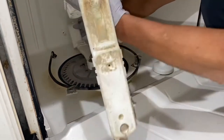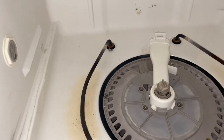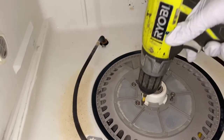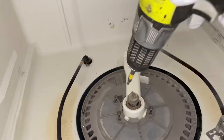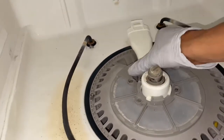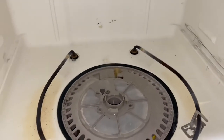Be careful when you're doing this because you don't want to break them. Next, take out the three screws around the middle using the drill bit. Once you take that one out, there's going to be a little screw under the arm — take that one out too, and then you'll be able to take the center cap off.